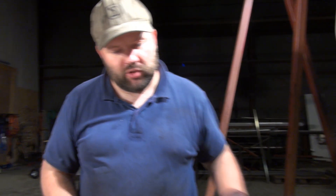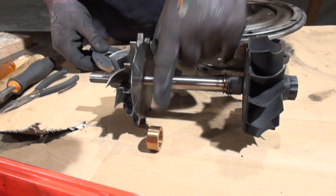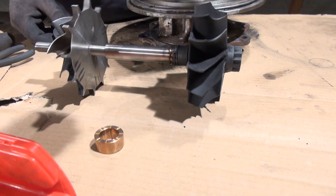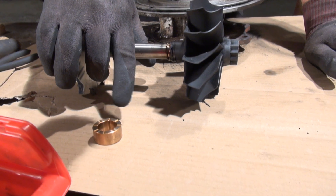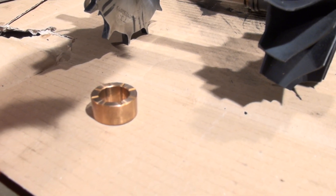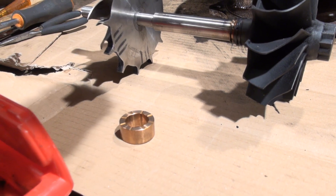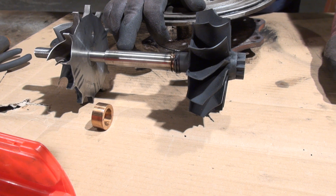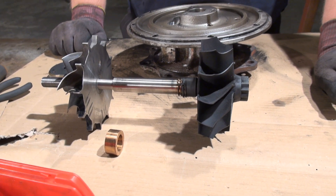There is a bearing system classic to this turbocharger — there are two bushings, one on each end. They are called double floating free-floating hydrodynamic bearings. The idea is that when oil is forced through these small grooves, it produces an oil film that keeps every metal part inside at a non-rubbing distance. This is what allows this shaft to spin at 100,000 RPM without ever really contacting the bearing material. It's a quite neat design, good for a whole lot of hours.